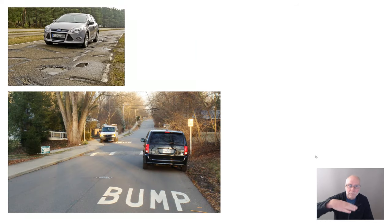Pitch is the up-down movement of the front versus the rear of the car. If we imagine the front of a car going over a speed hump, it goes up, and then when the back of the car goes over the same speed hump, the back goes up — this sort of pitching motion. And of course the same thing will happen on individual wheel bumps as well. Why is pitch bad? It's bad because it's the thing that we as people riding in cars find most offensive. It's not the up-and-down movement so much, it's not even the sideways roll movement so much — it's quick pitch accelerations. And if you think of your head on top of your body whipping back and forth as you go over those bumps that induce pitch, you can see it would be very, very discombobulating.